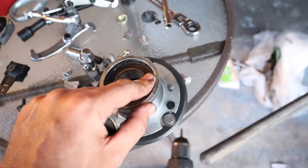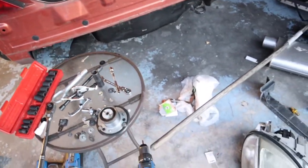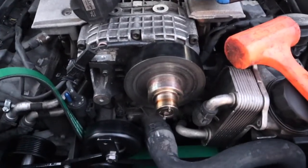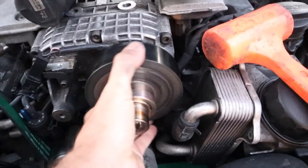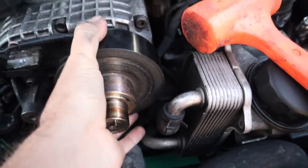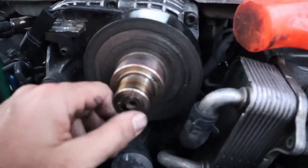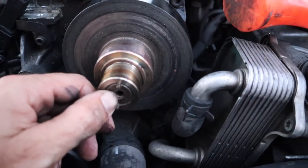You can feel a little bit of resistance in that pulley, but I'll throw it on sale — whatever someone wants to offer, we'll make a deal. Now, from what I understand, this drum is a little bit hard to get off because they're pressed on. So you've got to get a puller. I ordered a puller and we're going to pull it on there, then just whiz it off and be very careful not to break anything.